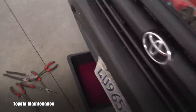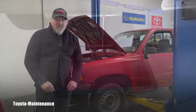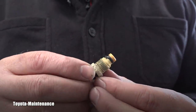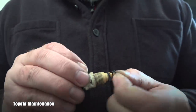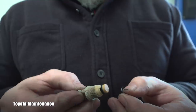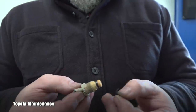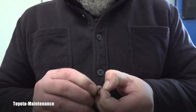It's still draining, and now we can together observe the reason why this was malfunctioning. You see that black part? That's the o-ring, which is supposed to be holding everything and stopping it from leaking. It's completely chewed up and broken — that's where the coolant was getting by and draining through that small drain pipe. So I will go through my o-ring set and replace the failed one.